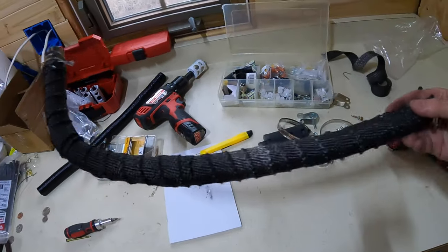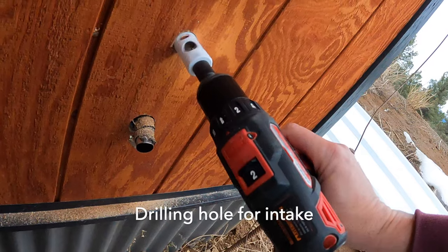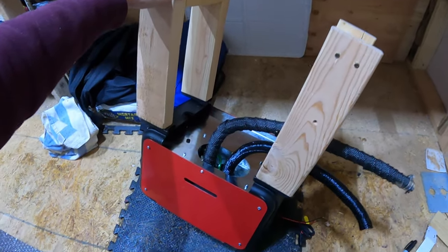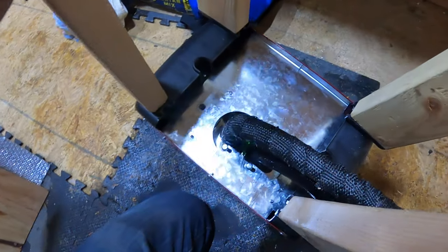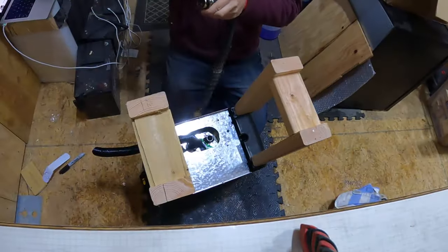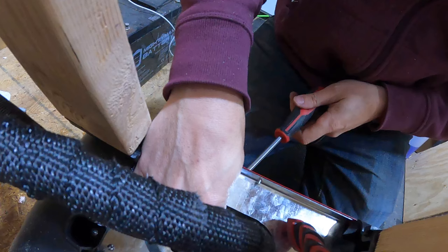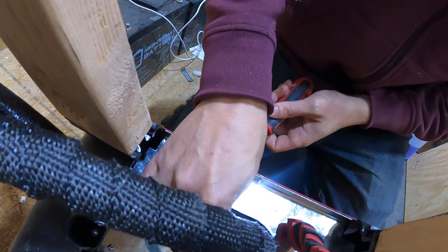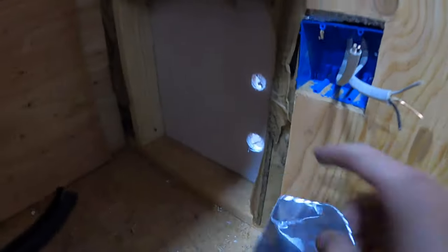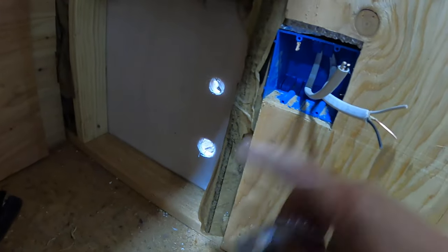Here's my exhaust, which I've wrapped with header wrap, using the clamps that came with the kit — I thought I had stainless zip ties but can't find them. I'm figuring out how to tighten the hose clamps, and they've provided some access holes on the side, so make sure you do this before you do everything else or you'll never be able to reach it again. On the exhaust hole through the wall, I'm also going to take some foil tape and put it over the edge of the plywood and vapor barrier to add one more non-flammable layer between the exhaust, the heat wrap, and the wall.